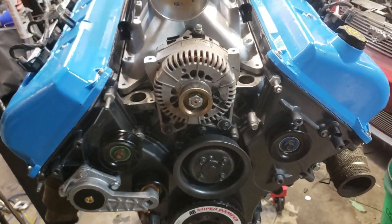I ordered a set of Bosch 210 pound-per-hour injectors to replace the 95-pound or 1,000 cc injectors we had. Our duty cycle was already pretty high on just 15 pounds of boost, so I figured we'd go ahead and upgrade that to give us a little cushion so we aren't pushing the limits of those injectors.